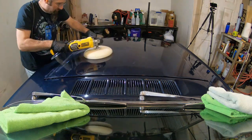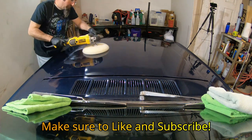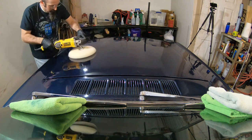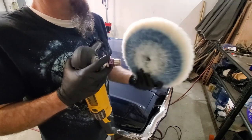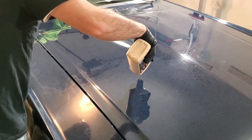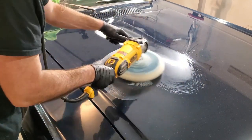After how long it took to cut that trunk lid, I decided on the hood to switch to the rotary with the nine-inch wool pad using Meguiar's 105 — pretty much the most aggressive combination I had. It still took two cuts with the wool pad, and after that I went over it again with the 21 and a microfiber cutting pad to get those scratches out. I was looking for maybe 90 to 95 percent correction to bring this faded, scratched paint back to life.